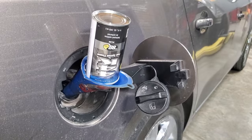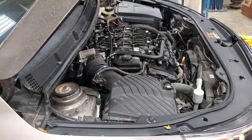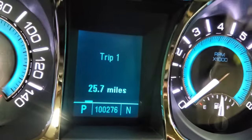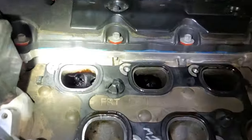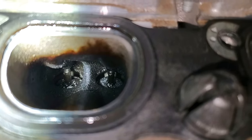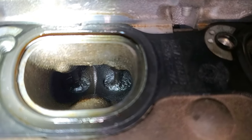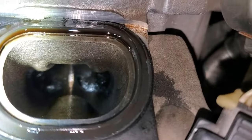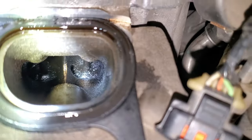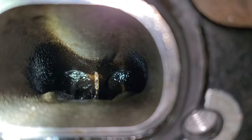I went ahead and put the 44K in the gas tank, did some full-throttle pulls to try to loosen up and remove any remaining carbon, and we put 25 miles on it. Now it's time to pull the intake off and look at those valves. I'm not very impressed — it's saturated and wet, you can tell the cleaner covered the deposits, but it didn't do that much. Maybe if you drive the car more, more will come off with time, but so far it's not looking all that great. It looks like walnut blasting is the best option for removing this carbon — this cleaner is maybe just for prevention and maintenance.